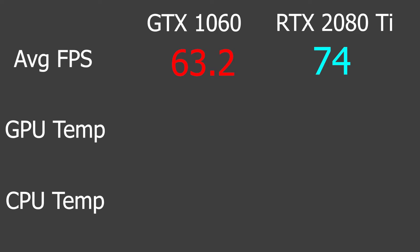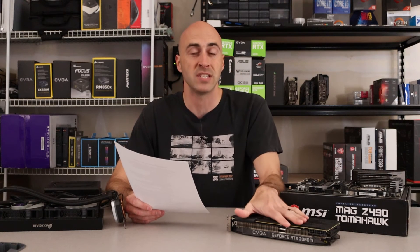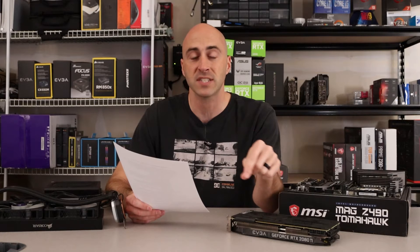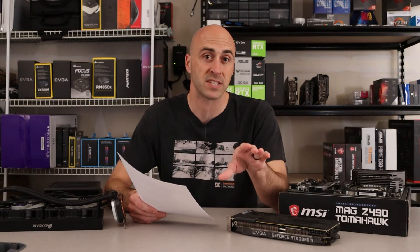For GTA 5, the big difference was the temperatures. The GPU temperature in the old setup was 68°C; in the new setup it was 35°C while gaming. GPU usage went from 90% down to 40% — because now the GPU is not the bottleneck anymore, it's the CPU. The CPU utilization went from 45% up to 50%, but the temperature dropped drastically from 78°C down to 50°C, thanks to the Hyper 212 and the improved case airflow.